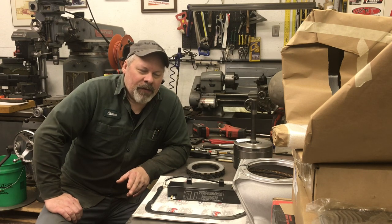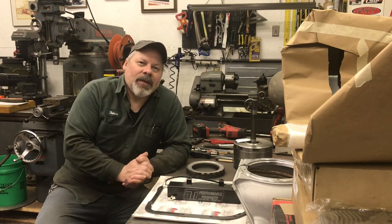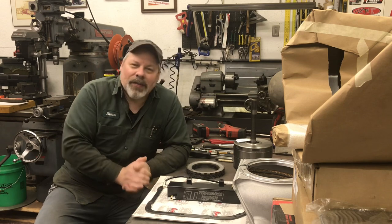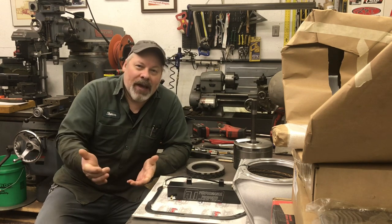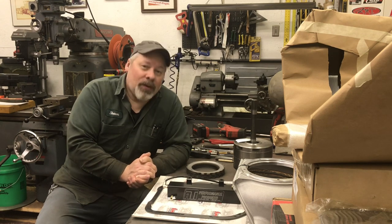The TH-475 you saw in the lead picture has a nice thick Chevrolet case — one of the best cases Chevy made. It's going to be an 8-bolt case when I strip it. It was going to break my heart to cut the bell housing off it because I wanted to run an aftermarket bell housing. I don't mind cutting them off when they're not Chevy — I'll cut an Olds, Buick, Pontiac, or Cadillac — but in this case I was going to be whacking off a perfectly good one.